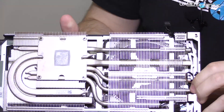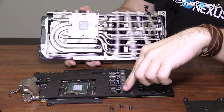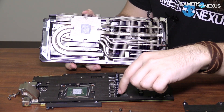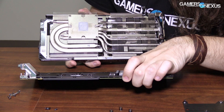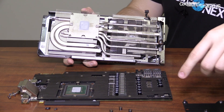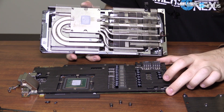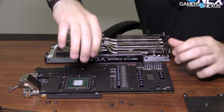The cooler lines up with the PCB like this. If you look at the PCB on the cooler, it shows a few things. Mostly, the chokes here — the inductors, which are actually a different kind of inductor I haven't seen this generation — those go in this slotted part, accompanied by the capacitor banks. And there are MOSFETs and more inductors. So for the phases, it's a 14 plus 3 phase power design — 14 for V-core, 3 for the memory. In theory, you get a little more stable voltage. I'm not sure if it's using any doublers or quadruplers or anything.